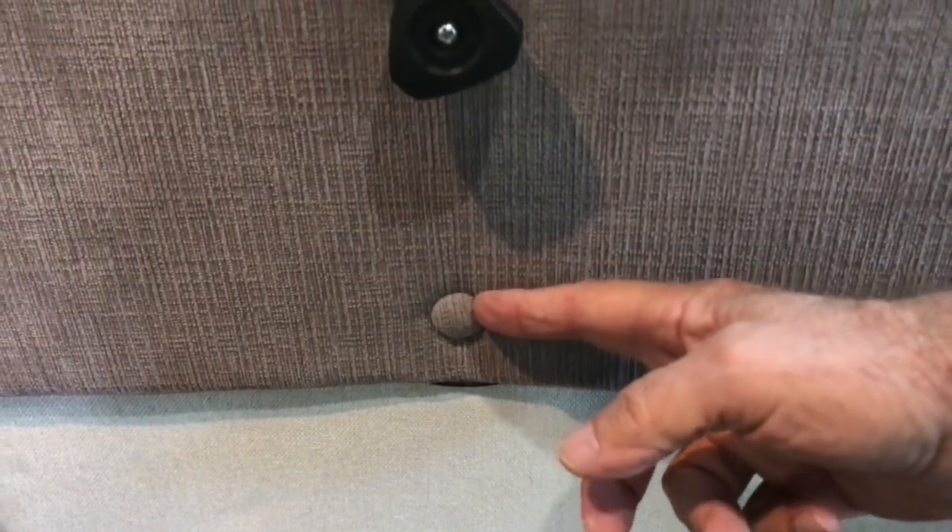We have the wire coming down through the door. I have it through the inside, through the screen there, and then I kind of tuck it around inside. The unit is powered by 12 volts DC, and I have a 12-volt DC connector actually mounted here — that little red dot you see, that's it right there. I tuck the wires in under here; there's a little screw you can loosen, and you can pop the wires inside under there. I tuck them all around up to where I mounted the antenna itself, which is right there.